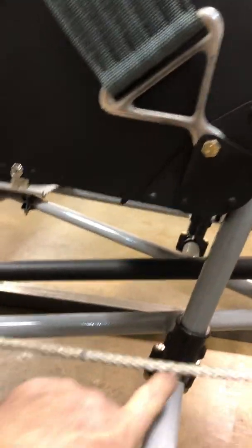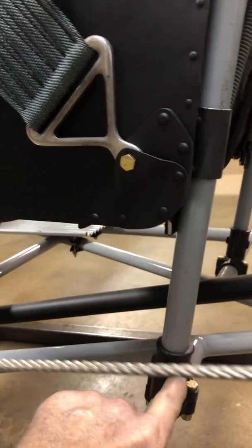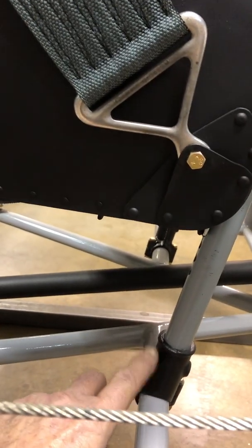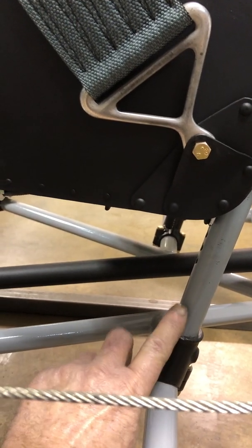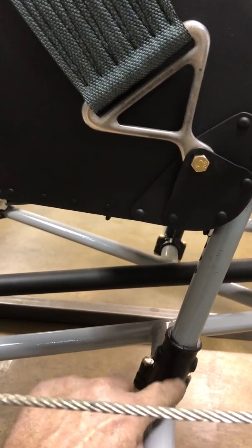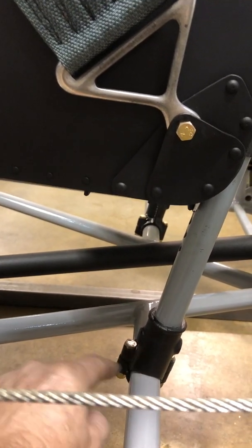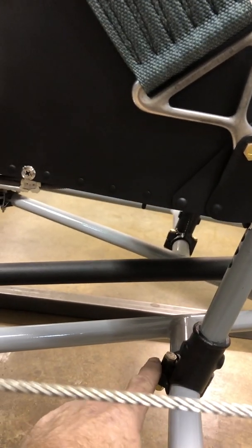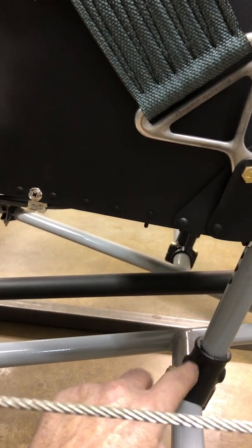What I have to do is change the receiver for the two seat rails, because the seat gets mounted to that bar by these two. So what I'm going to have to do is get two pieces of pipe. This one will receive the seat rail, which is 1 inch. That's not going to change dimensions. The front one's the same as the back one. So the idea of this pipe, which is chrome moly 4130, it'll be 58 thousandths, and just cope it and notch it so it'll go around the other pipe, which will be right here for 1.25 inches. This one's for 1.8 inches. This is cast aluminum, mine will be steel.